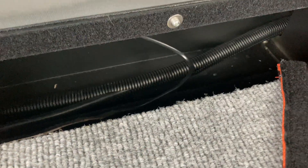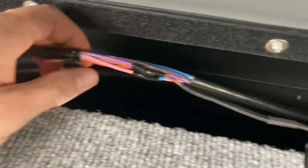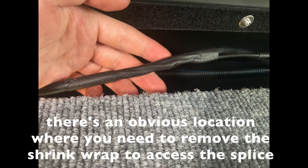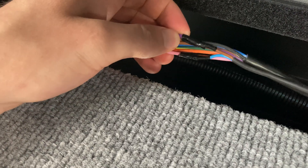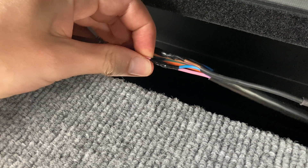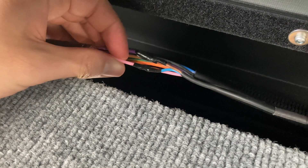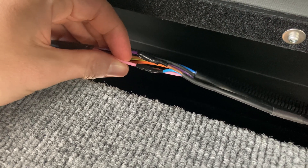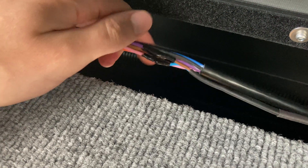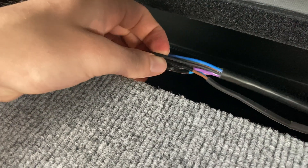I'm here at the high brake light which goes into the light right there and splices into the main wiring harness right here. I'm going to leave the brown and purple alone. Right here you can see the blue negative from the tail light is spliced into the pink common negative from the camper wiring harness. I'm removing it from the pink and I'm going to splice it into one of the unused wires from the harness - I'll put it into black right here.